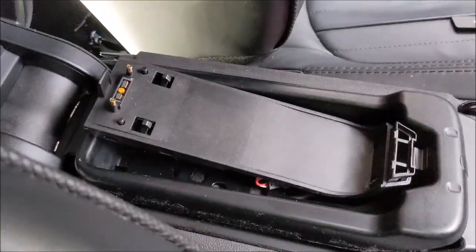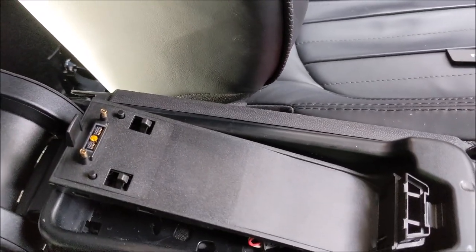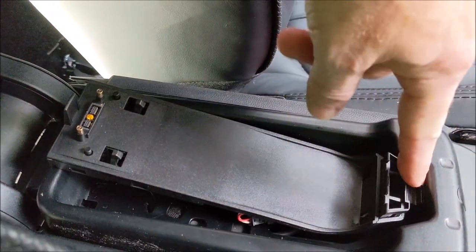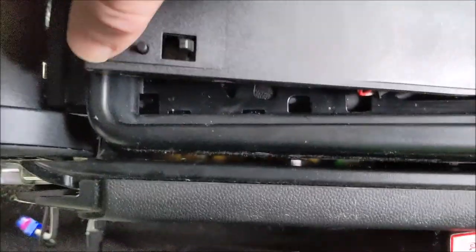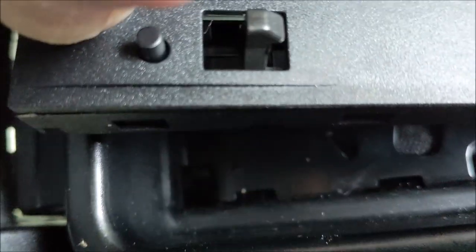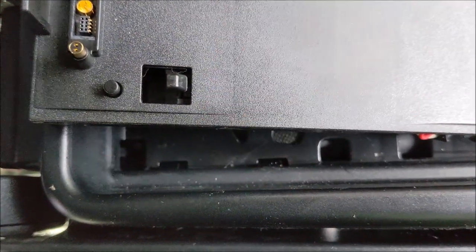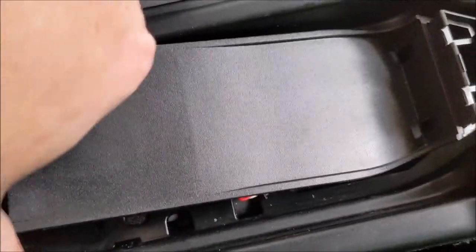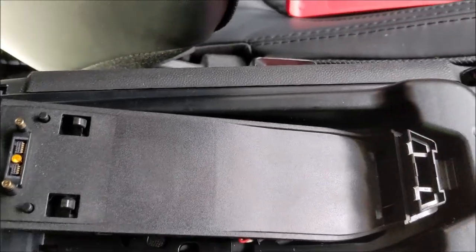We've arrived at the easy jobs that aren't easy jobs. I spent quite a bit of time trying to get this out and still haven't managed it — mainly because I was tackling it from the front end. The reality is, if you look down the back here, you'll see a couple of holes and further down there are little clips. If you get the wedge or your trim tool down the side and push those clips back, that's what releases this. However, the cables are firmly wedged on the underside and I cannot lift it out.